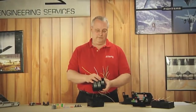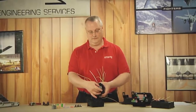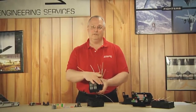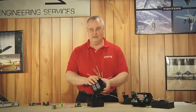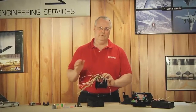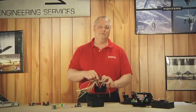I'm going to go in and replace the terminals going to this relay. I'm going to choose this one only because I can get my fingers in it. I'm going to go in, grab the relay, and pop it out. Now I'm exposing the terminals from the front face, but let's take a look at the back side because that's where all the work is going to be. Remember from previous chapters — there's a primary and secondary locking tab, and it's no different with the fuse box.